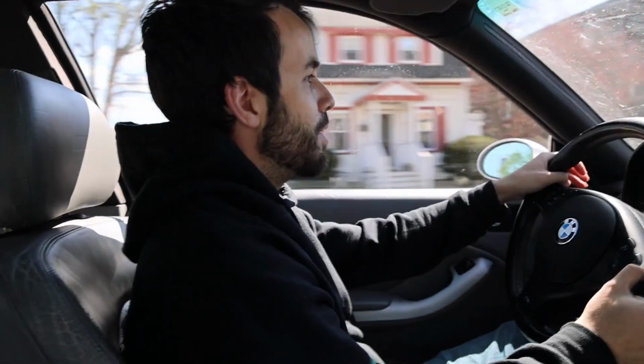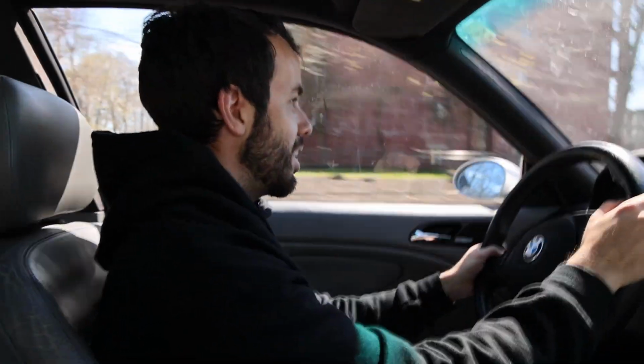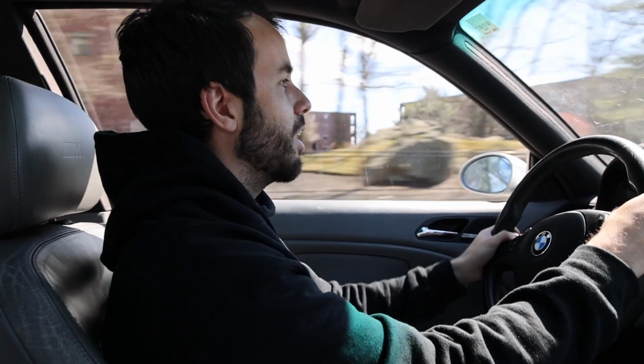And we opted for the Swift springs specifically, with spring rates designed more for daily driving than track stuff. A little softer spring than what most people run, because I told them I wasn't going to be slammed, which I guess I'm not. It's low, but it's not slammed. So I'm okay with a little bit of suspension travel, and I'm not going to be tracking this car. But we're on not the smoothest roads, and so my biggest worry was setting the dampers.